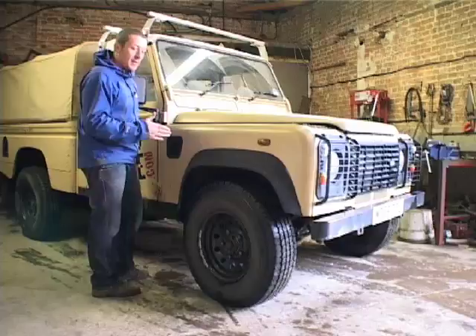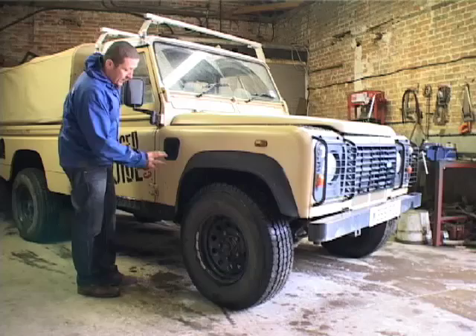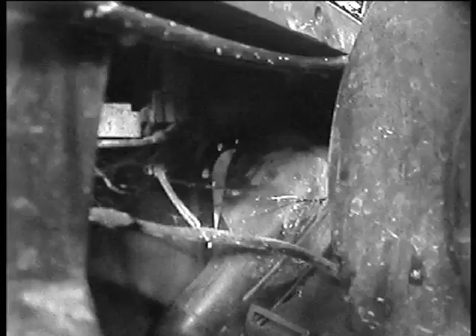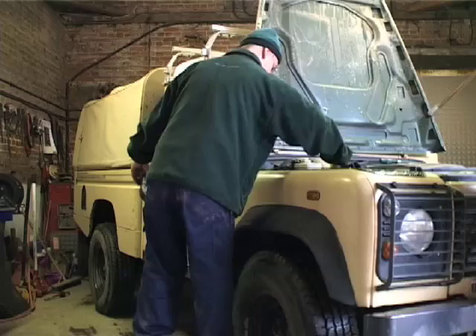The first thing we're going to do is fit the raised air intake. We take off the side air intake cover and the blanking cover on top of the wing. This gives us really good access into the area where the existing pipework is. Here is the flexible pipe that leads back onto the air filter, and we just unscrew the air intake from the outside, which slides out. That's removed from the tube and we're going to be using the flexible pipe again.